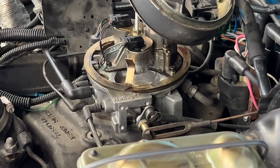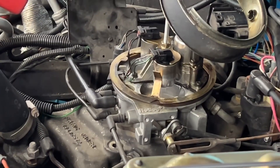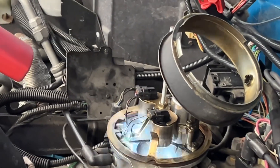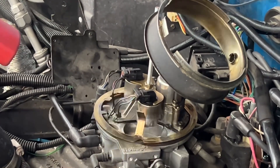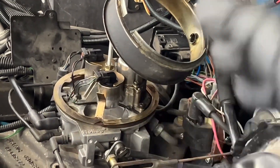I'm not seeing every flash from the gun through the phone, that's for sure. But the injector on the passenger side looks more like rain dropping down, whereas this side's got a nice conical spray pattern going down. Nice little trick.